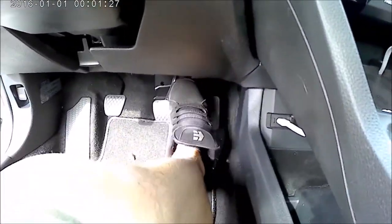When I'm coming into a corner and I'm downshifting, I've got the inside of the ball of my foot on the edge of the brake pedal and I would just rock my foot to rev match when I downshift.